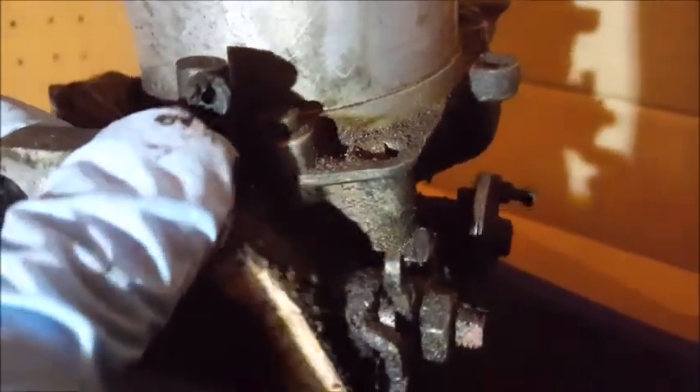Then, if we can go around to the front, there's a small, thin plastic hose that goes on here — that just slots into there. It just pulls out by hand; it's not too hard to pull out. And that attaches to the top end of the distributor. I can show you the distributor here — it just goes on this nub here.